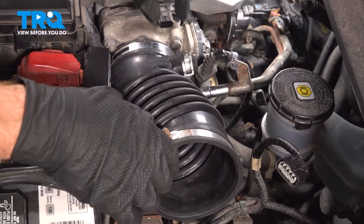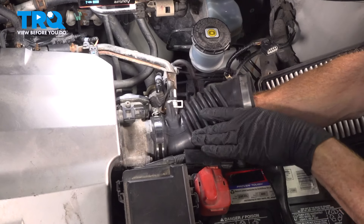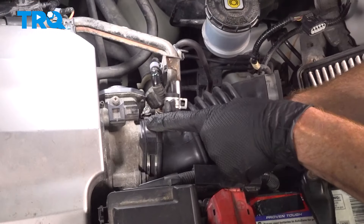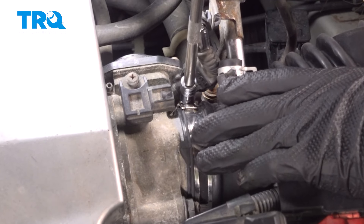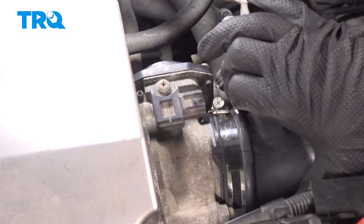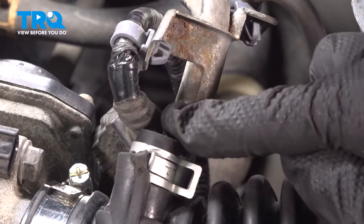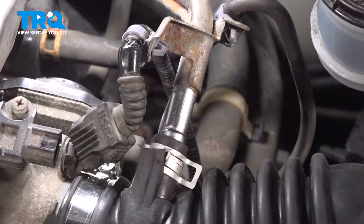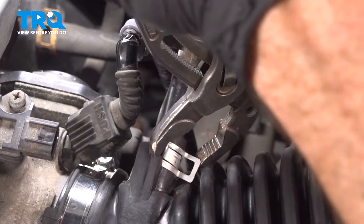When installing this, we want to make sure we have it matched up with the throttle body, pressed on as far as possible. To help align this, I just have my hand inside of the inlet tube — that helps me guide it to where it needs to be. Once I can see that I'm clearly aligned, let's tighten that clamp. Take hold of the inlet tube and try removing it from the throttle body — if it slides off, you have not tightened the clamp well enough and you're going to have a running condition. Now let's move along to the smaller tube. Get it aligned, squeeze on that clamp, and slide it in until it's completely bottomed out, then hold it in place with the squeezable clamp.